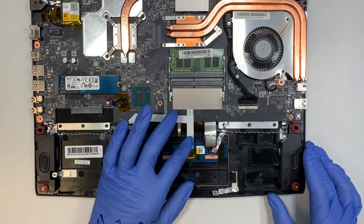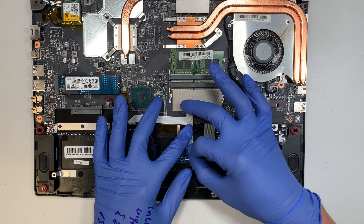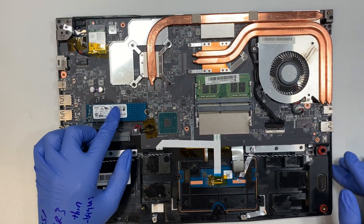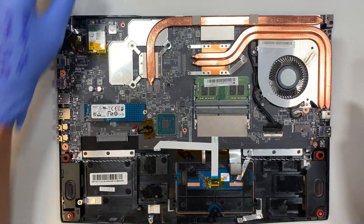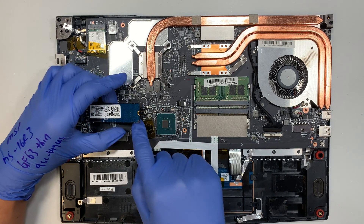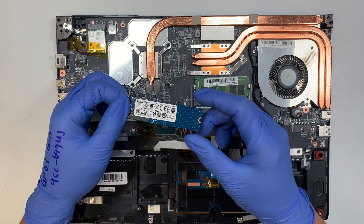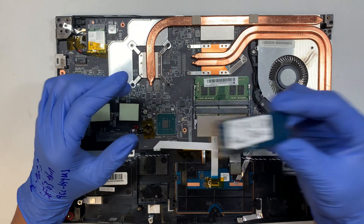Here is your M.2 SSD drive — that connector over there is the touchpad connector, TP stands for touchpad. To remove the M.2, go ahead and use the Phillips screwdriver to remove that one screw. Lift the M.2 slightly — it's a little sticky because there's a thermal pad on the back of the M.2 drive, which acts like a sticky glue. You need to gently lift it up slowly. Once you have it at about a 45-degree angle you can slide it to your right — that's how you remove the M.2.